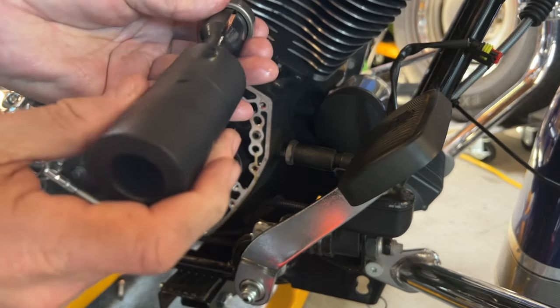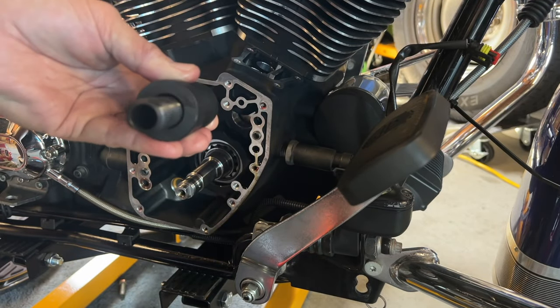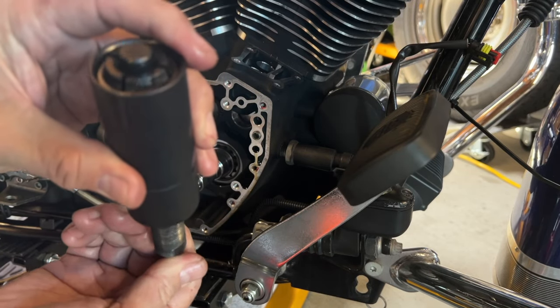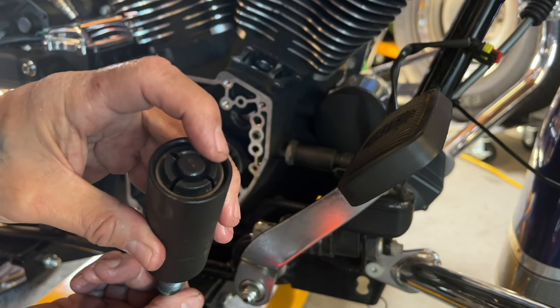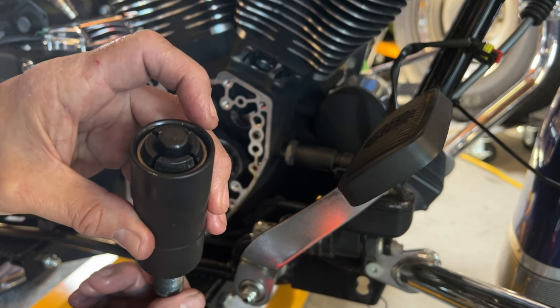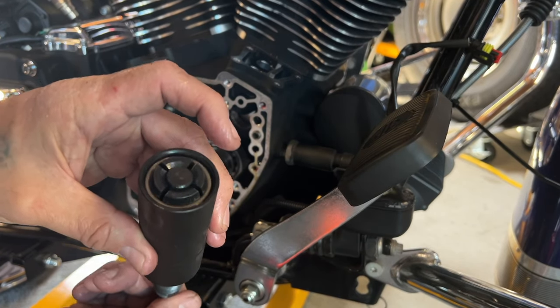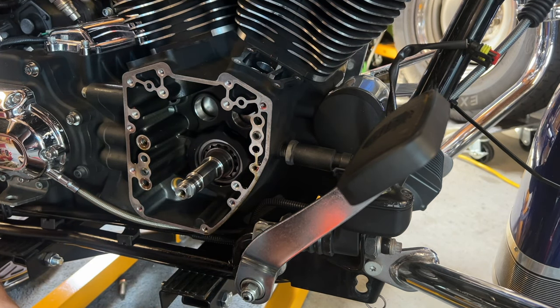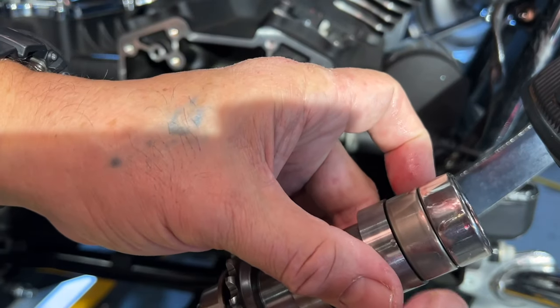Let me get this all the way out so I can show you guys. You can see these lips right here — it's rounded off and then it's got that lip where it actually grabs the bearing and the bearing can't go anywhere. The way it works: you get this, put your nut on there, get a hammer, and when it's seated you tap it in. You tap it in and it goes in, keeps pushing until it passes that lip and locks in place. Then you put it over, get your rod, put that over — and when you tighten it up it expands and pulls that bearing all the way out.